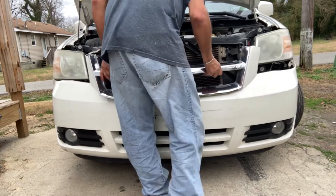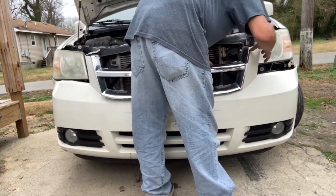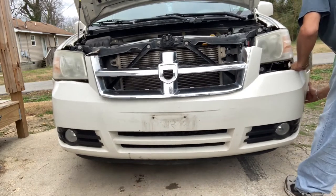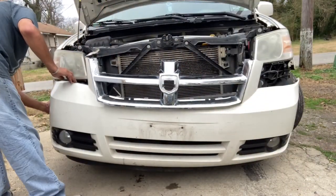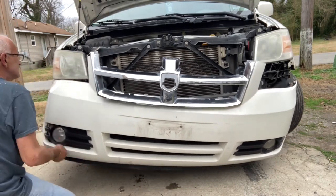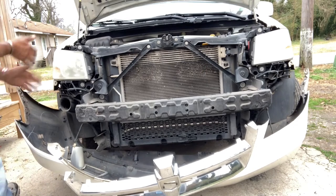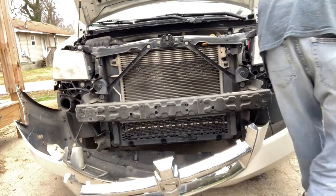Now I'm going to take the bumper cover off. The grille piece has tabs that lock into the bumper cover. During the incident the chrome grille basically unpopped itself out of there. The way you take the bumper cover off is you grab it from the front corners, lift the bumper up at an angle, and then slide it off the tabs. Now I'm looking at a guide tab that was busted on mine — that's what I was looking for.